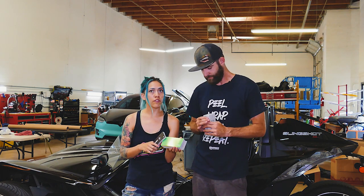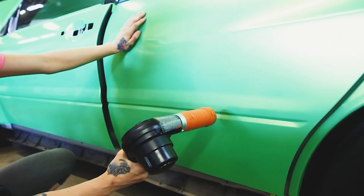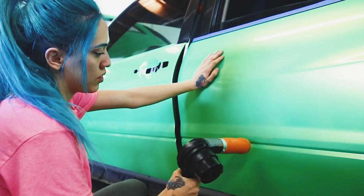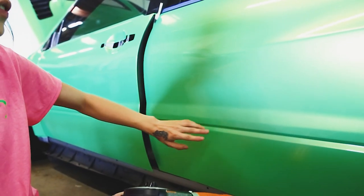Last but not least, it's very important to post heat everything — you've got to bake it down. Post-adhesion is critical. We found that even small simple recesses and corners wanted to pop up over a couple of days while the car was here. So you need to do that edge sealing and all that extra post heating.